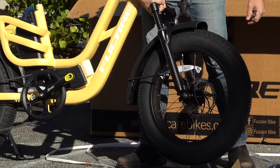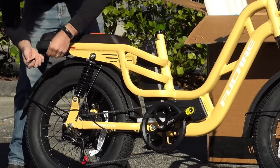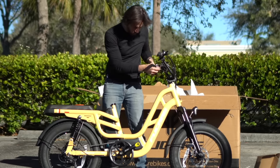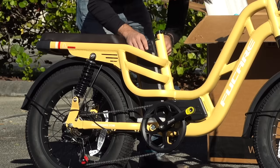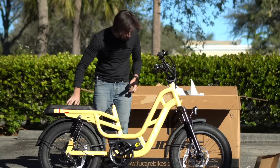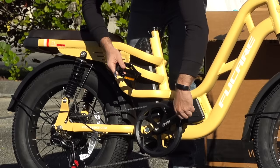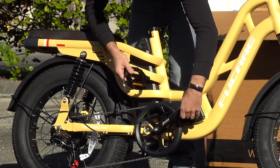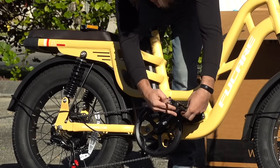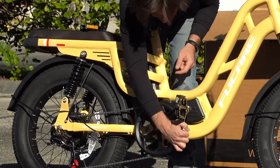The back fender has to be bolted on separately — not sure why they don't bolt that on for you. I'm going to take the keys out to remove the last bit of foam under the battery. We've got a 48 volt, 15 amp hour, 720 watt hour battery. For the pedals you want your 15 millimeter wrench — they come labeled. I tell people to just turn towards the front of the bike so you don't have to remember that the left side is reverse threaded. The mediocre quality pedals mean the bearings aren't so nice that the pedal just spins freely — they'll tighten right down.